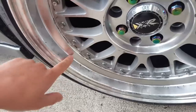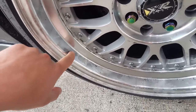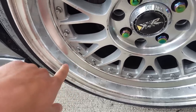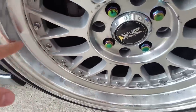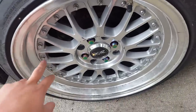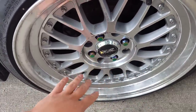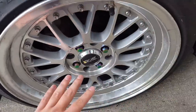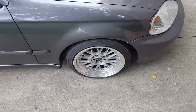This is what the wheels look like right now — a little dirty with some brake dust on there, but if I wipe off that brake dust you can see we have this peeling clear coat right here. It's been peeling so long it might be starting to corrode a little bit. I'm gonna take this wheel off first, prep it, get it ready to spray with paint stripper, take all of this clear coat off, and then polish the wheel so it looks new. First let's get this swapped out with a different wheel.